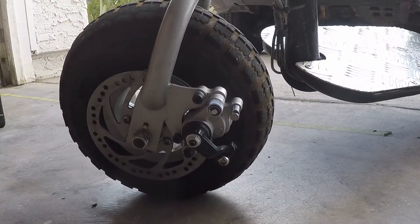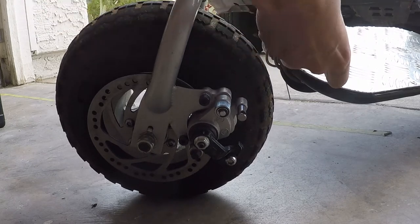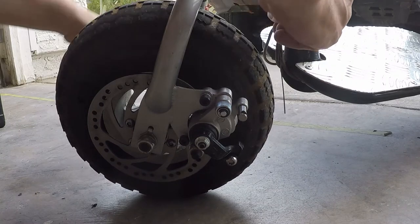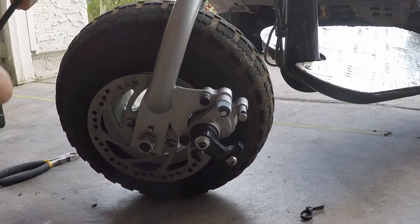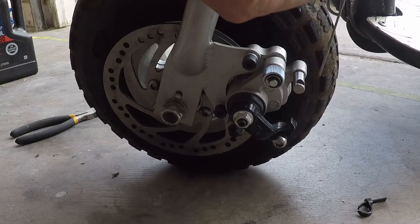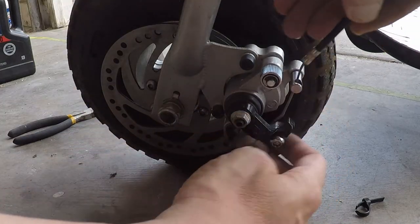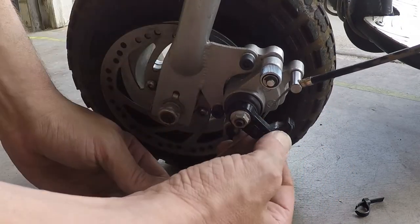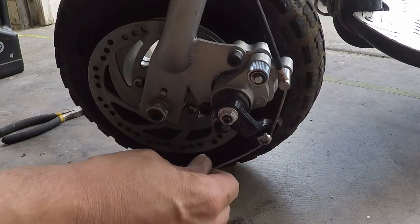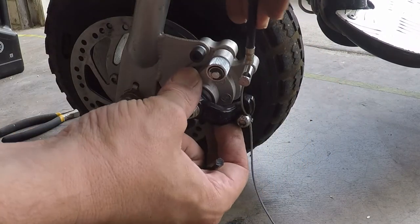We're still rolling. Now we're going to take this brake line that was pushed up here and forgotten about. We're gonna feed the brake line right through this holder — stops right there. You put your brake line in the holder, you slide the wire behind the nut.